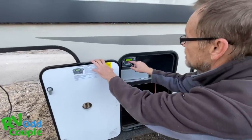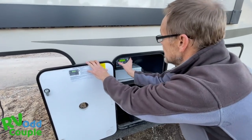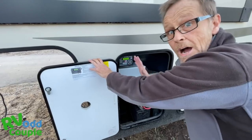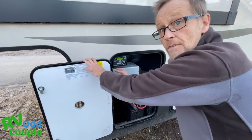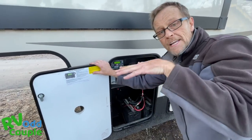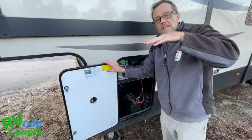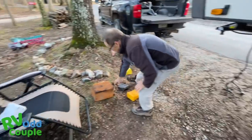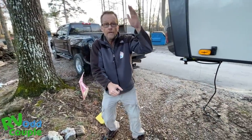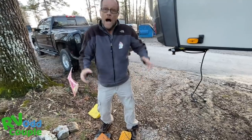I'm only a quarter of an inch side to side, so right now I'm in great shape. You can also hit auto level, which will start the system leveling process automatically. I like my rig as low to the ground as I can possibly get it. If I do have to be high off the ground, I'll use blocks under my landing gear, because the more my landing gear is extended, the more wobble will be in the RV. Blocks under the landing gear keep that wobble out.